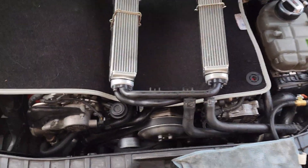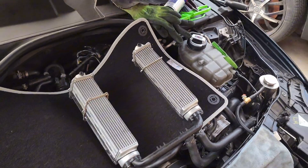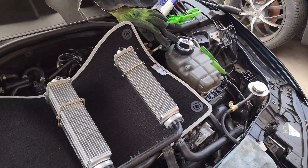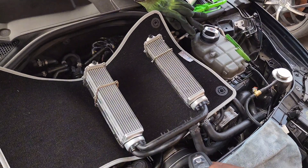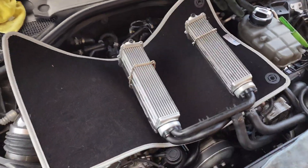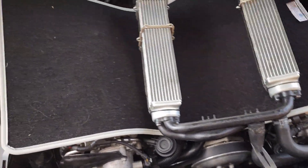What I'm doing is since I have the PWM pulled and I've got the CWA 150, it puts out a pretty good amount of pressure through the intercooler. So I just activate it — unlock the key and it activates, you can hear it. Then you pinch the return line — the other one's the feed — and you can hear it pressurize.